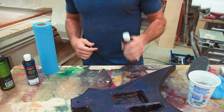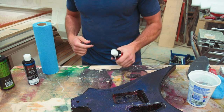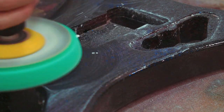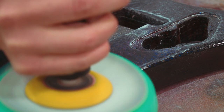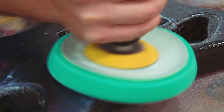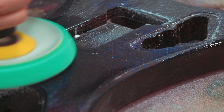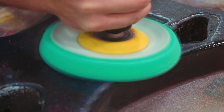Make sure you give that a good shake — there are some solids that can collect at the bottom, so you want to make sure those are mixed in. Arguably I used a little bit too much compound here, and you can see kind of a mist coming off this thing because the pad's a little wet from me just cleaning it. But you don't really need much — you just need enough to get a decent coat, a little thin layer on the pad so that it's not scratching up the surface with the pad itself. Load up your pad a little bit and you really don't need a whole lot of compound when you're doing this process.